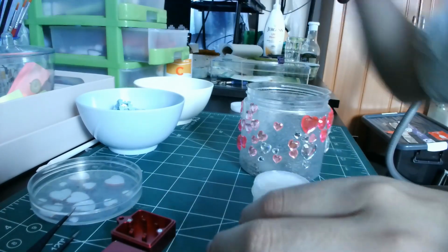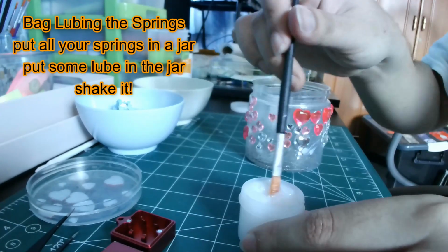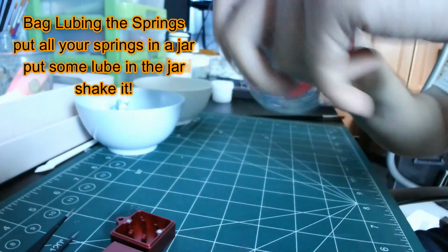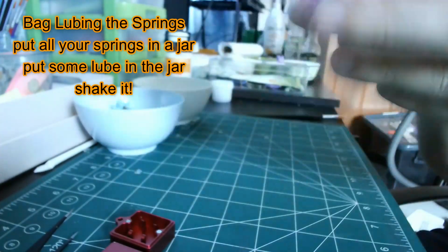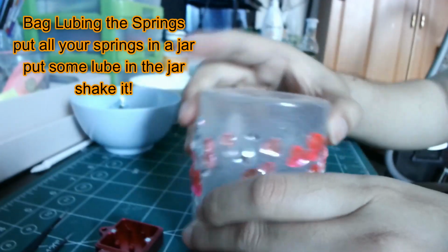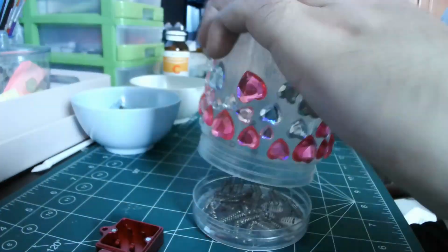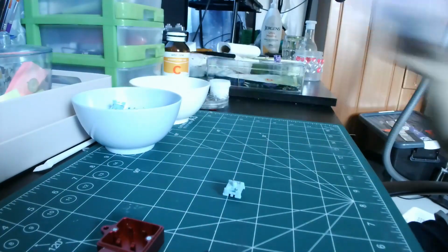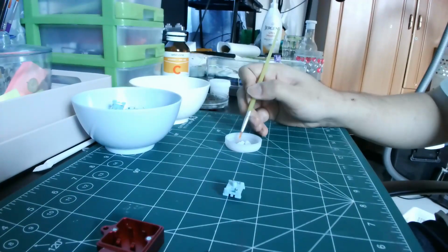So now we are going to lube the switches because unfortunately the Akko Cream Blue V3 switches still have a significant spring ping to them, and the switches came in really dry. There's no factory lube anywhere, so the switches themselves are really dry. So I highly recommend you lube these switches. Lube the spring, lube the housing, lube the stem, lube the top housing, and then put them all back together.